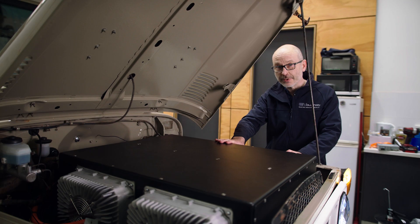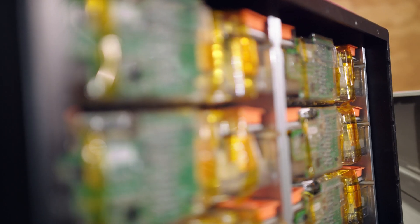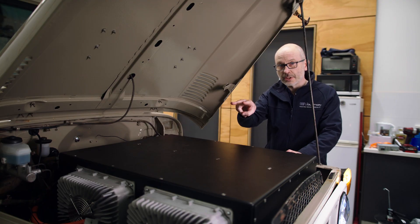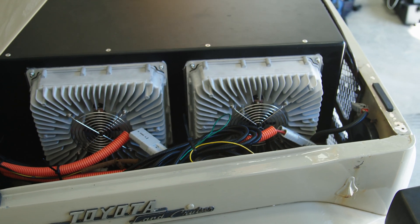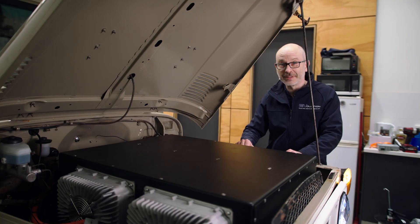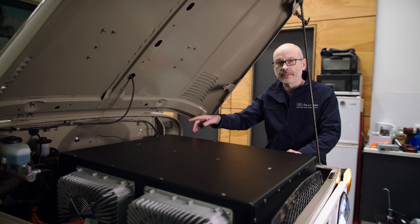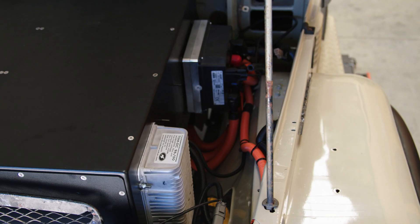We've got the battery box underneath here — six Tesla cells, all in series for around 150 volts. We've got two chargers on the corner there giving us around seven kilowatts all up, DC to DC, and the motor controller here as well, whirring away. It's actually running now — can you believe how quiet it is? And in the back we've got the penthouse, the PDM, and all that kind of stuff as well. It's all pretty neat under here now.